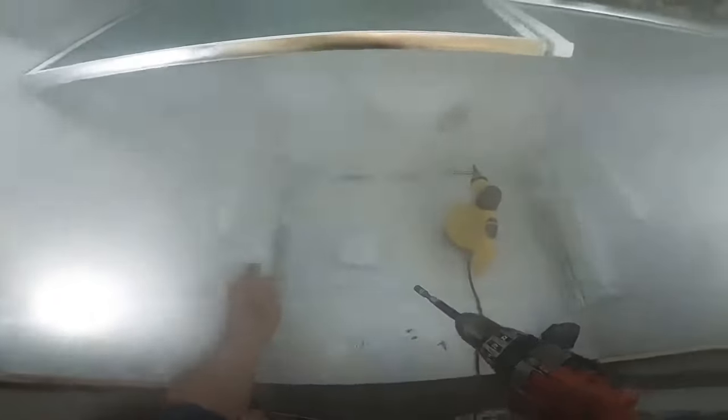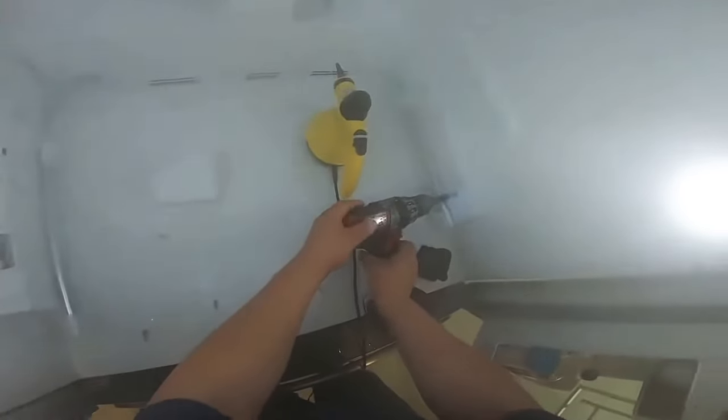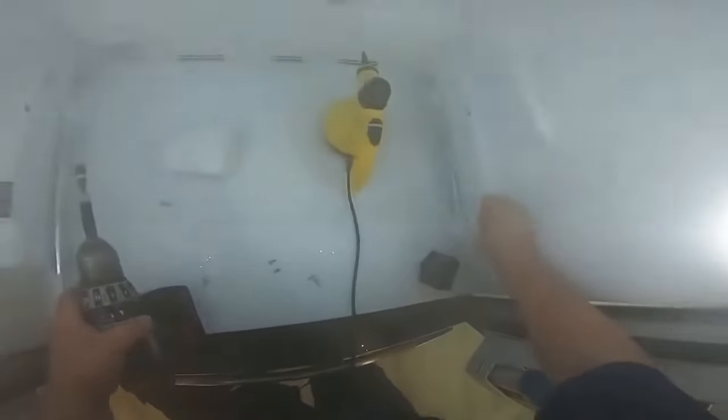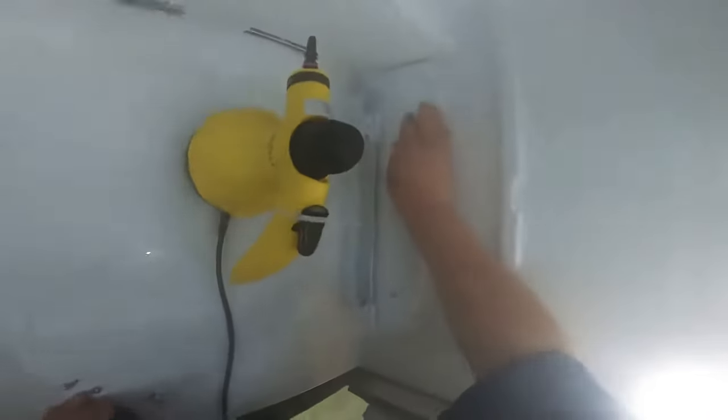I have a steamer here to help me defrost everything — that's why the footage looks blurry, because the steam is doing its job. Sorry for the footage quality but there's no way to avoid it. Now remove the one-quarter screws from this panel. Remember there's ice behind these panels because the fan motor looks like it's not working, so sometimes these panels are a little hard to remove. I'm hitting it lightly to try to break it from the ice.